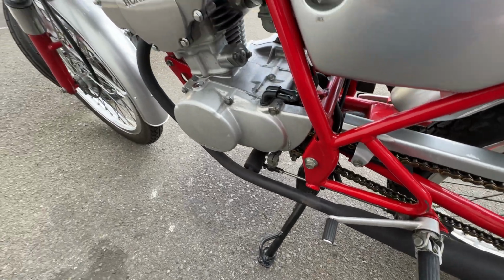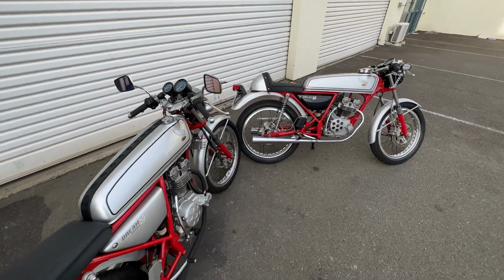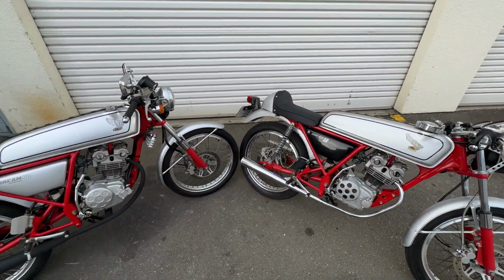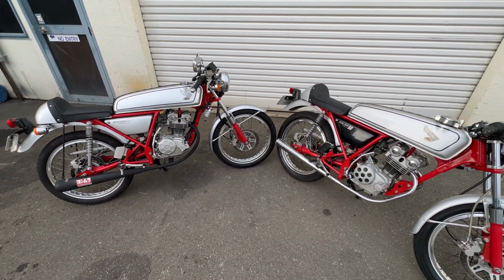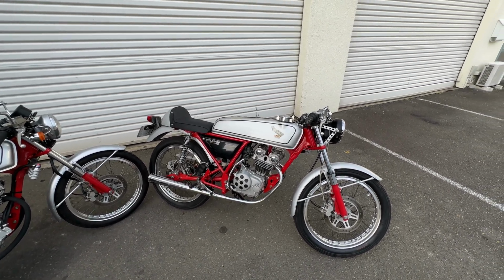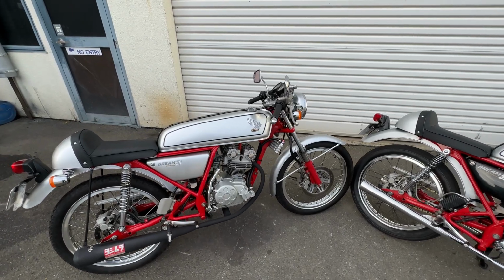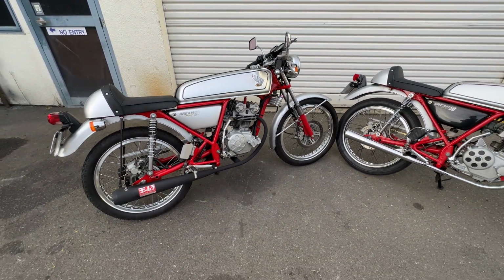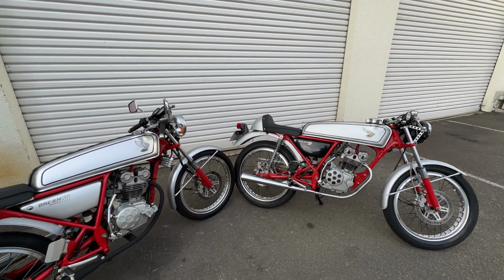When these first came in to New Zealand, I was comparing them to another 50cc manual that I'd ridden at the time, which is a Yamaha RZ50, and they were a 6-speed 2-stroke, and I did face these off. The RZ50 in fairness had an aftermarket expansion chamber, and it also had a CDI that let the revs go up a little bit higher than normal, and it had been tuned to suit that pipe. So that thing had a bit of pep on these, but I'm really interested to see what speeds I can get out of them today.